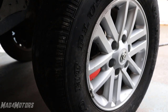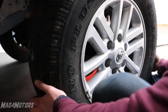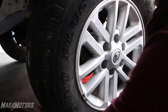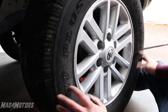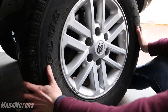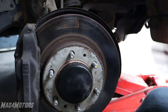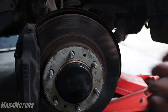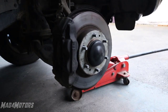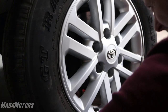The next big issue people have with changing their wheels is the actual weight of the wheel. On some pickups or SUVs, the wheels can actually be quite heavy. What I like to do is get my legs underneath it and use my legs to help lift the wheel. This way you can use both your legs and your arms to lift the wheel into position. Also, I put one stud at 12 o'clock — that way if I line the wheel up at 12 o'clock it should slip straight on. Sometimes you're going to get your clothes dirty, but when you've got a flat on the side of the road, you haven't got any choice.